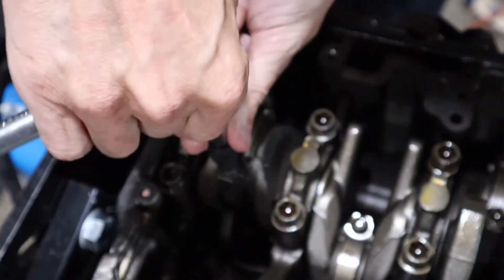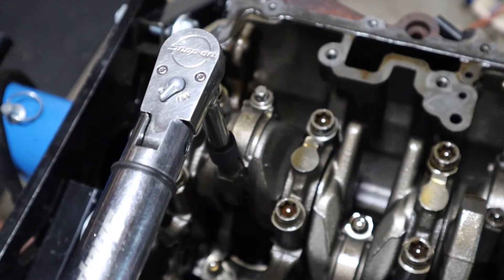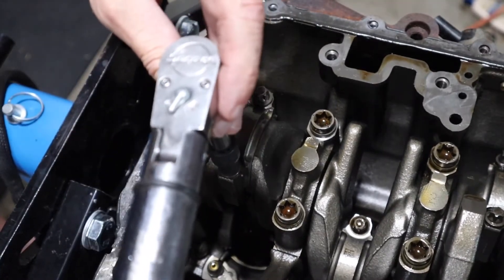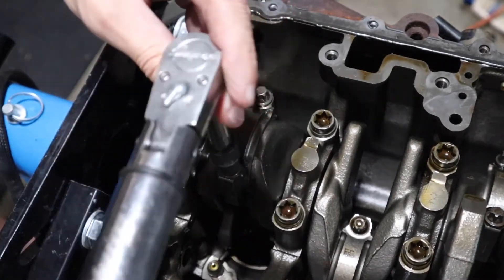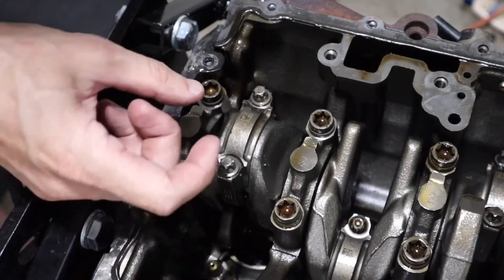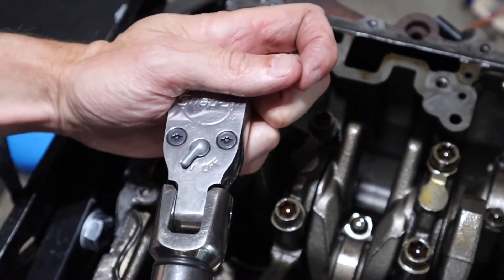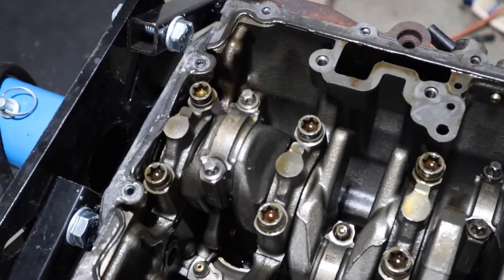Torquing this ever so slightly, nice and even back and forth. The spec here is 8 newton meters, then 12 newton meters, then 18 newton meters, then 35 degrees — they want this torqued in a very even sequence. This is a digital torque wrench so it's easy because you don't have to convert foot-pounds to newton meters. Going up to 18 now — there's 18. Really important: don't accidentally turn the engine, because that piece of plastigauge will get smeared and you won't get an accurate reading. For the 35 degrees I have a torque-turn wrench — set it and forget it. There's 35 degrees on this one, and 35 on this one.